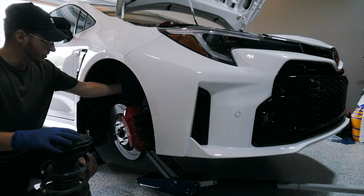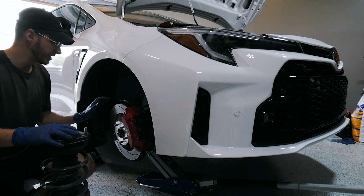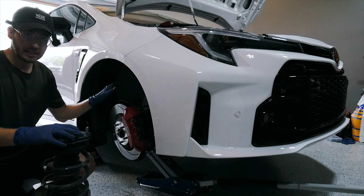And what you have to do is rotate the axle by spinning these. I just put a lug nut on here and spun this around, and you just keep pushing, and then it will just click in all of a sudden. The CV joint or the axle popped out, and I spun the hub a little bit and it misaligned everything, and I was not able to push the knuckle back up afterwards. I had no idea what was going on in that moment, and I was kind of freaking out. What I do is go straight online to Google, YouTube, whatever, and try to look up what's a common mistake that people make. I ended up finding a video that showed me what to do to pop it back in, and you basically just spin it around and keep pushing it forward, and it does pop in.